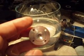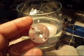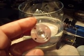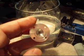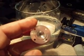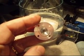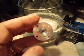The concept is that you take these two holes and put them over the head button so that one hole is right on the edge of the bowl — both holes are inside the bowl, with one right next to the squish band. You inject water from the syringe into the bowl through the other hole, allowing air to escape out of the top hole next to the squish band. When the bowl is totally full, you look at the syringe and subtract its current volume from the volume you started with. I started at 0.40, so whatever I end up with I subtract from 0.40 — that gives the volume of the bowl.